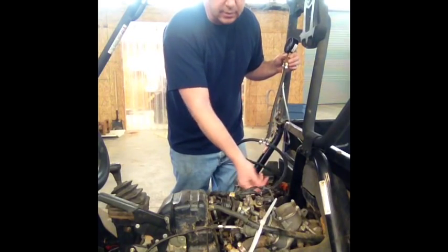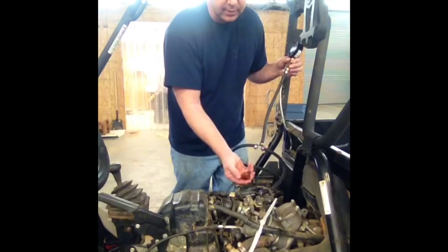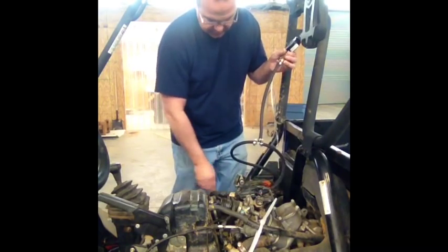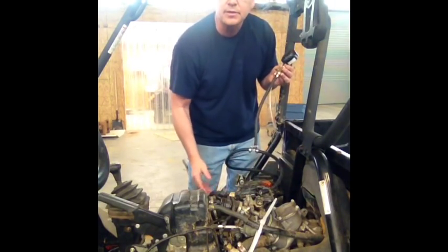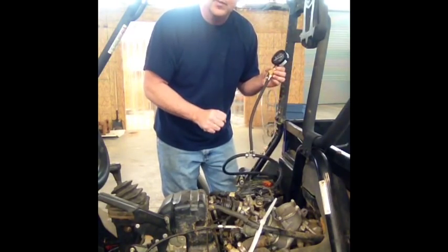And what you do is you take your fuel line off your fuel rail at your throttle body. Got these quick disconnect fittings, pop it off, slide your line on, use a clamp, clamp it down real good. And the same thing on your fuel tank. You'll have a connection there, same thing, slide your line on and really clamp down that hard. That's plastic, don't break it.